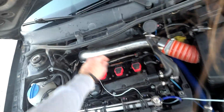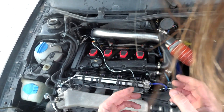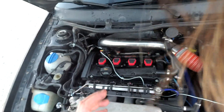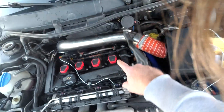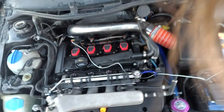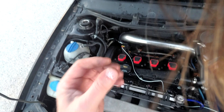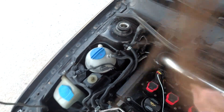This section is not so bad because it is clamped to the engine bay, so there's not that much movement with regards to the hose versus the engine bay and the cables. But nevertheless, there is some. I put my finger around all the places where this hose touches cables, plastic fittings or whatever. While nothing was badly damaged, you could tell that things were a little bit scuffed. For that reason, I personally would not fit these in an engine bay.